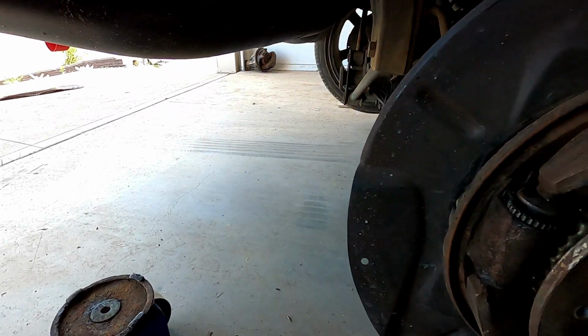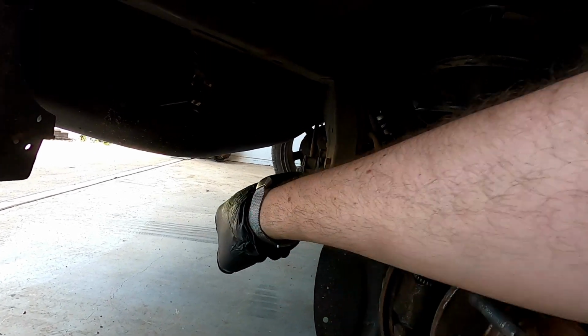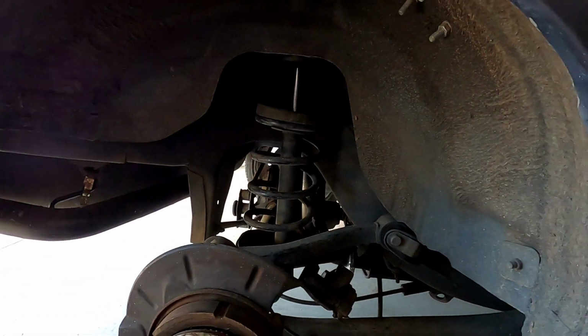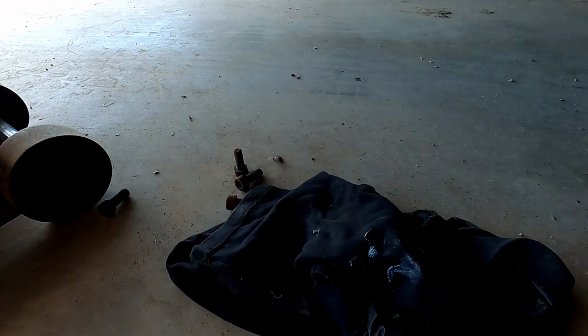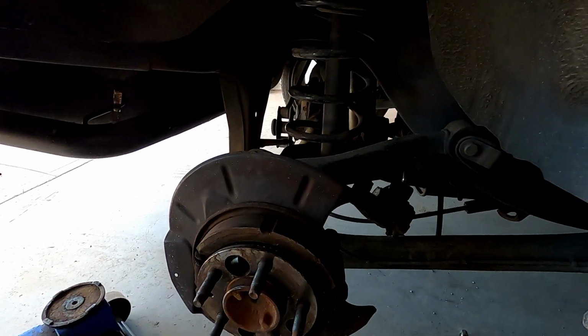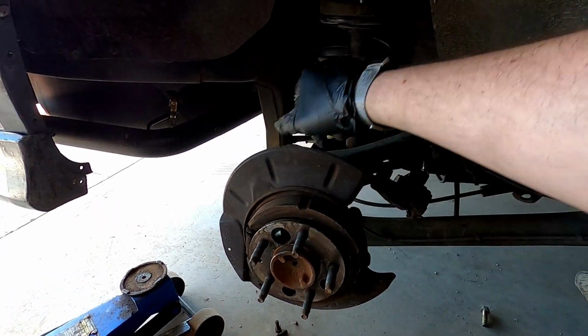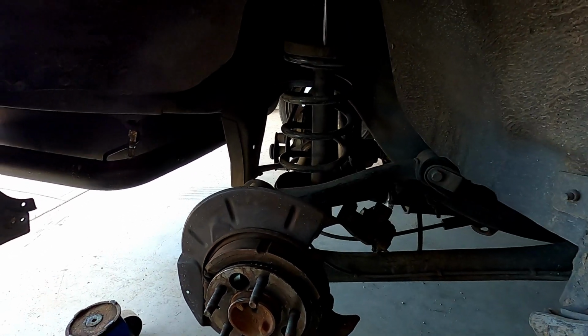And then I'm just gonna go underneath there, pop the Watts link arms off the diff cover and then undo all the bolts, pop the cover off, and we'll undo the diff. And we'll see how bad it is. So yeah, the diff oil is coming out of the wheel seals here, also looks a little bit silver. So I think the inside of that diff chewed itself to bits. So we'll go back on the other side, do the same thing, come back when we start taking the arse end of it apart. And yeah, we'll drain it.